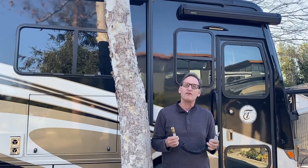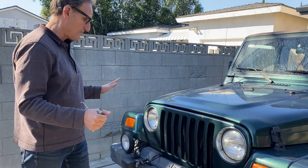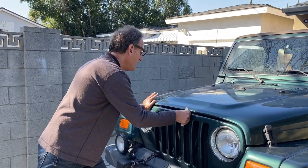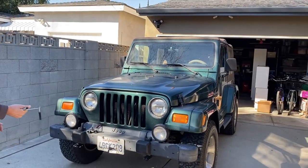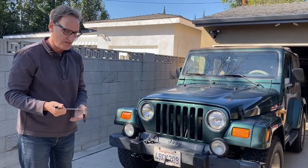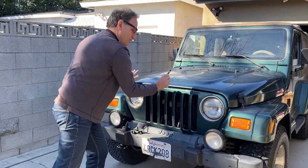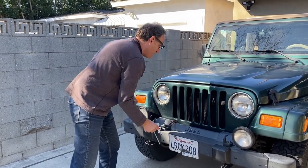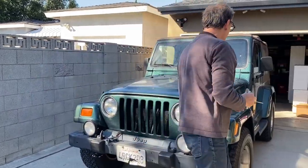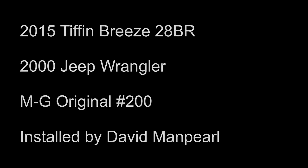The next test we're going to do is testing the breakaway system. I'm going to push the car and it's going to roll just fine, and when we yank out this breakaway pin it should stop. And it worked perfectly — and that was from charging it up last night when I had it connected to the RV. Yeah, it ain't moving at all — that is locked. And I push this back in, and suddenly it can roll again. It released the brake. There's our breakaway system.